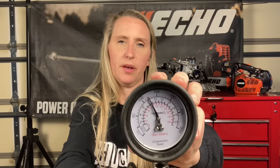We get a good reading after about three pulls and we have 120 pounds of compression, which is really good. When testing compression, if anything is below 100 pounds I do not work on it — that always leaves room for it not running to its full potential, and I can't have customers thinking I'm not fixing it correctly when actually it's a dead unit. So if it has 100 or below, I don't work on it. 110 is good. 120 is pretty perfect. A lot of the big backpack blowers will have 140 or 150 — that's fine too. You always have to check compression because if it's too low, you don't want to be putting a bunch of money into a dead unit.